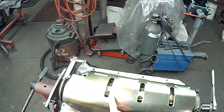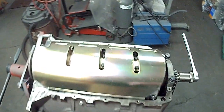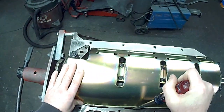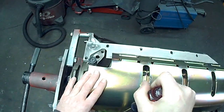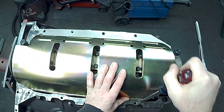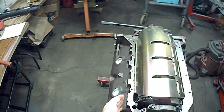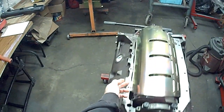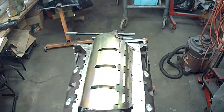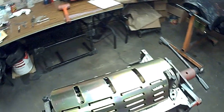It utilizes all three of the main caps, or you could just use two of them. I usually like to get a screwdriver and bend the pan inward, carefully of course, and get some of the oil to scrape like the factory windage tray. The crank is turning this way, so we want to get the oil out right away here, which will go down into the oil pan, and then it will come across and all these louvers will scrape the oil.